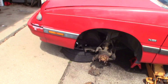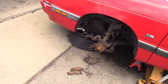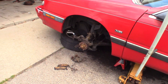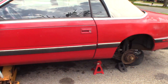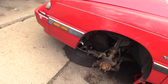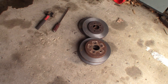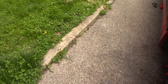So I got this '91 LeBaron — this is the convertible one. It needs brakes really bad. All of the brake parts are special order because it has front and rear disc, which was an unusual combination for a convertible. It takes a special size rotor with a different size hat than the smaller rotors they sometimes put on these. Rotors were like two weeks out, so I took the old rotors down and turned them — got everything out of them just within minimum specs. We're good to go there.